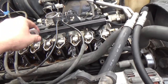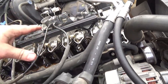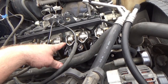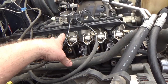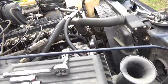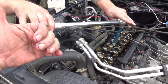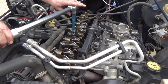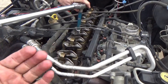Take your ratchet and go across all your rocker arms — just snug them down. They're not like a Chevrolet where you've got to set a valve lash with a certain gap between the valve tip and rocker arm. On the 4.0 Jeeps and 2.5 as well, you don't have to worry about that. Tighten them down snug, then take a torque wrench set to 19 foot-pounds and torque them all down. No special sequence needed like head bolts — just start at the front, work your way back, 19 foot-pounds on each one. Keep your fingers relaxed on the torque wrench so you don't skew your torque settings — just have your hand riding to steady it, pull with fingers open, and you can hear it click when you're there.